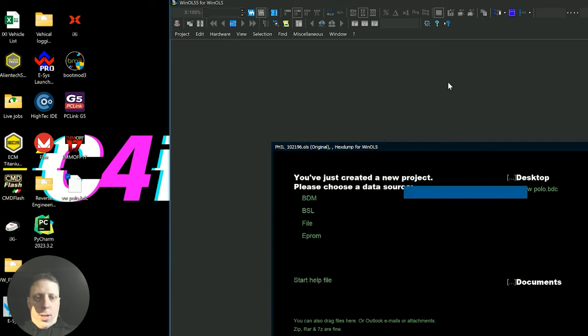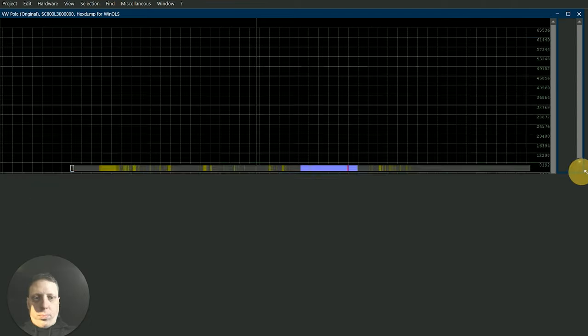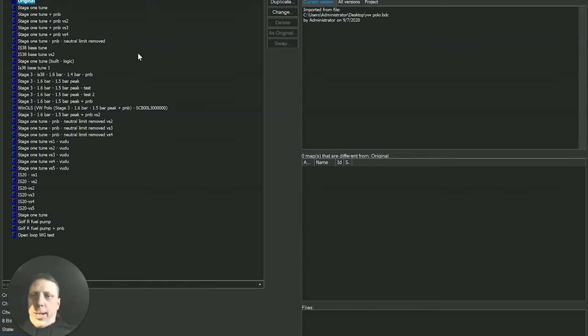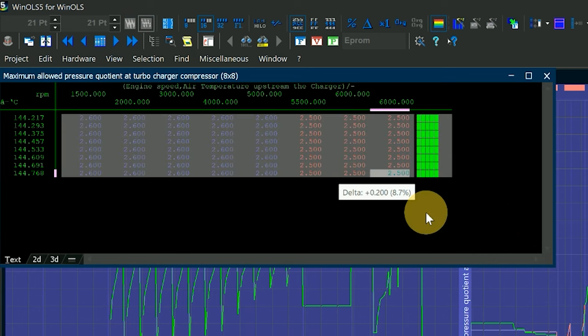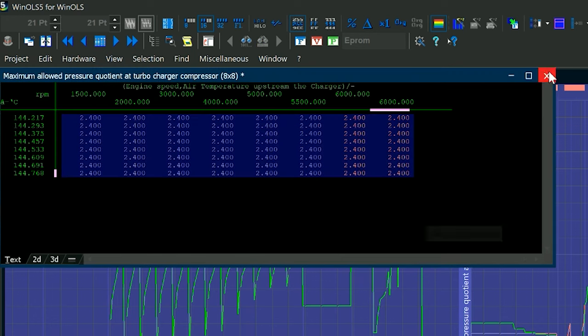Yep, so I've already got a version and it's a full map pack, so anything blue says that there's maps there. So open a version up I've got already. Obviously done a few of these. Stage one, checking out what boost I'm going to be running. So 1.6 bar, 1.5 bar red line. I'm probably going to drop that down at this point just to see